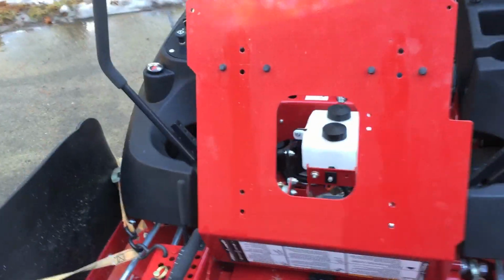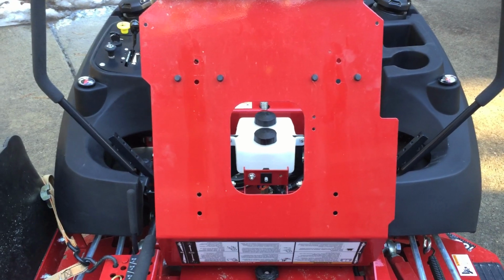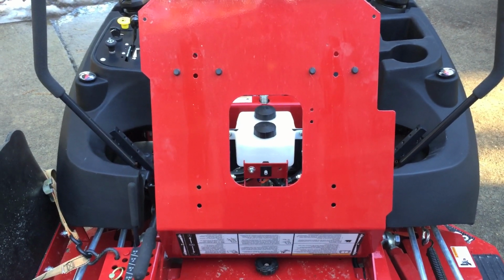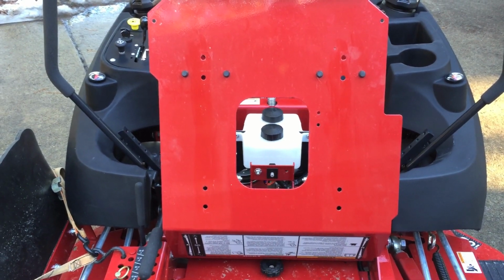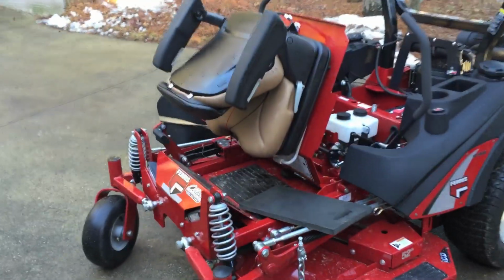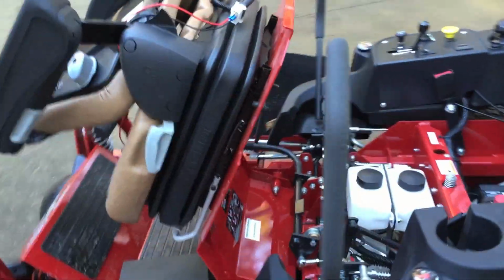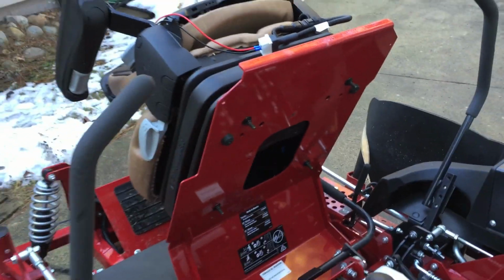The IS2100 series comes with two sets of holes, which are the industry standard 11 1/4 inches wide by 11 inches deep. The stock seat comes mounted on the rearmost holes, which, as we're looking at the seat pan tipped up, are the top sets of holes. As you can see, a Grammer 75 series seat bolts straight up to the stock seat pan on an IS2100